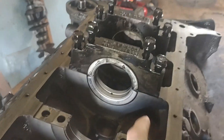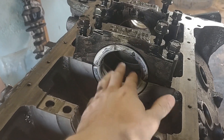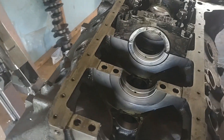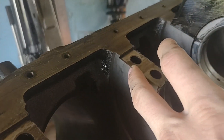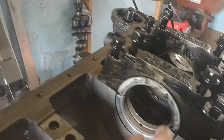What is main web cracking? It has to do with your engine block itself. It is not something you can just put a little scope down the bore to see. The only time you're really going to see whether you have a main web crack is when you remove the motor and drop the oil pan. You can rotate the crank over to check out all of the main webs. You have your main cap that holds the crank in place inside the bearings, and on the other side you have your main web, which is cast into the block. A main web crack is a crack running the length of your main bolt or stud holding your main cap down.